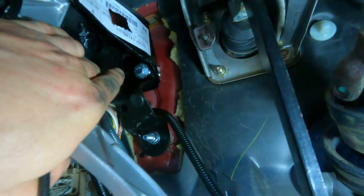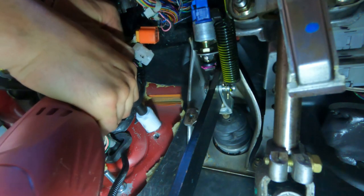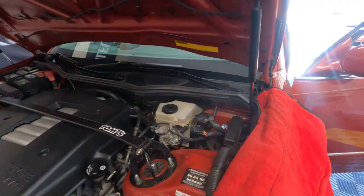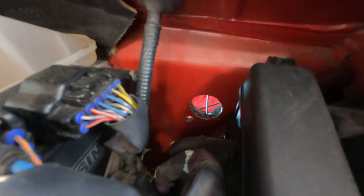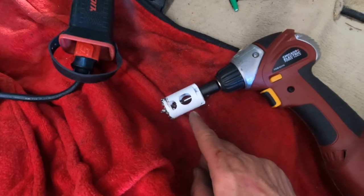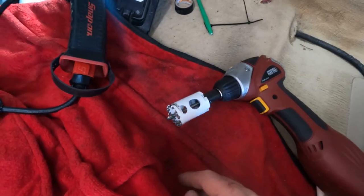Right now, because I have it tacked in place, I'm going to mark off the hole for where the clutch master cylinder comes through the firewall — that's the reason I tacked it up. I also want to point out why you need to cut this Mark 4 pedal assembly, because it will interfere with this otherwise. There it is — this is a one and three eighths inch, or 35 millimeter, hole saw. It's a Milwaukee, I got it at Home Depot for 14 bucks. That is the size you're going to need if you're running the 80s Land Cruiser three-quarter bore clutch master cylinder.